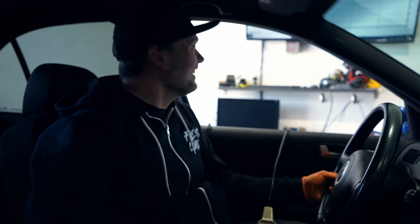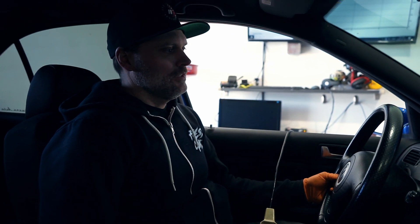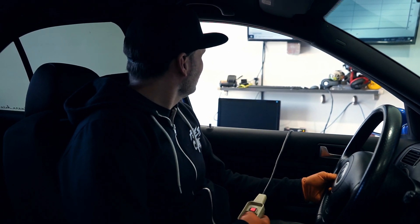This is the way the car's been driven forever, so this is how it is. The power band is going to be completely different when we're finished — completely flipped around. All the torque is at 3200 RPM and by 6000 RPM it's basically gone, down to only 150. It'll feel a little different — he'll drive it differently for sure. We're going to do valve train in it, so I rev'd that one out to just around seven, and we'll probably go to 8200 or so. This thing would be out of horsepower by that point with the current setup.